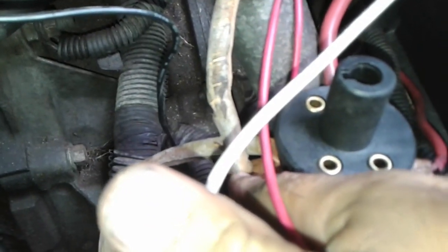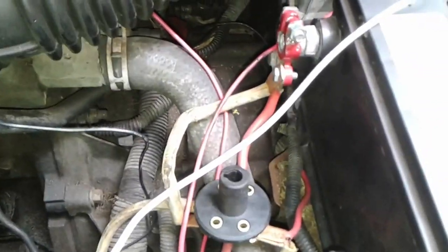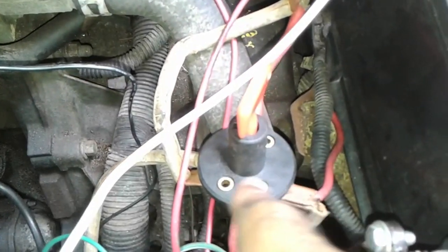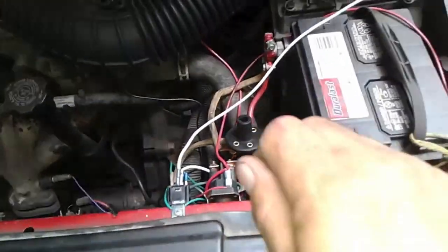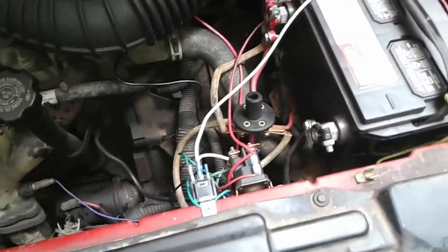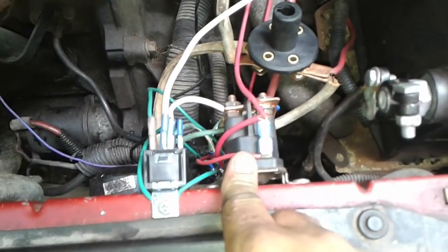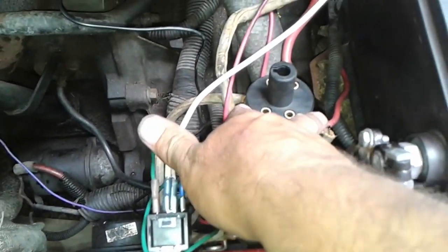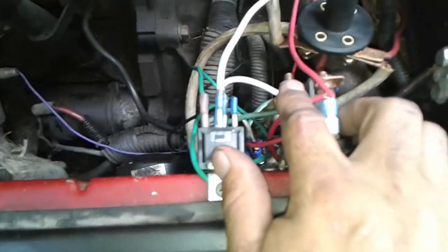From the other side of this switch, I've got it going up into here, so when you have your key turned on, power is coming from the battery through this little switch and into the original wiring. What you do is leave the key in the on/run position, but the car is not going to run because the power is cut off right here. That's what this solenoid does — when you contact these two points it actually turns on the same circuit that the key switch would. This is what connects your battery to the car's electrical system.